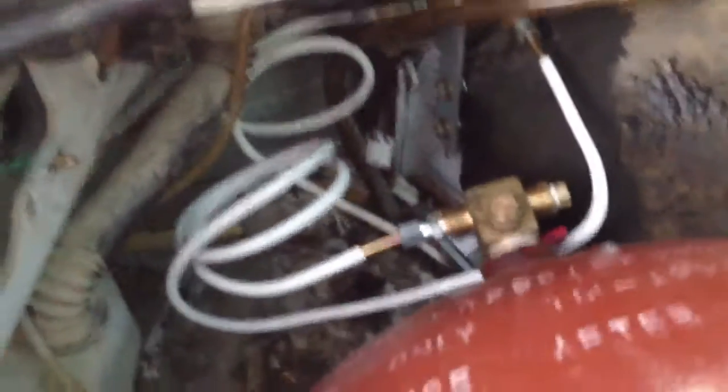This is my 6mm compression fitting tubing. You can see the fill nozzle — there's the valve for the fill nozzle — and the tubing will go out right through there, run underneath my car, up to the regulator.